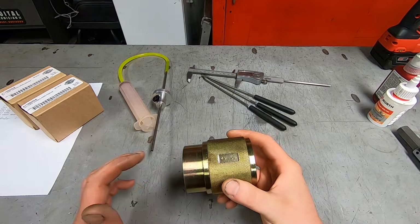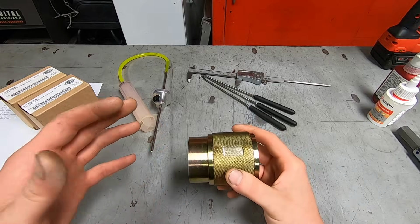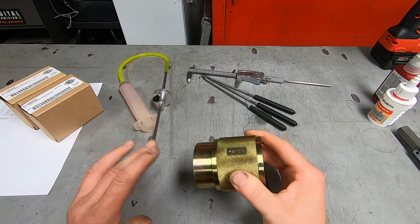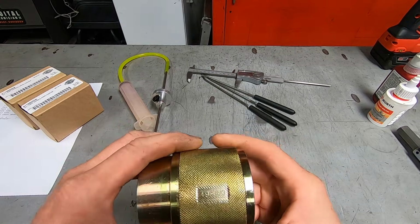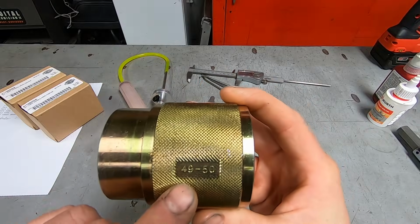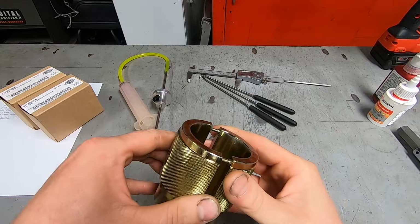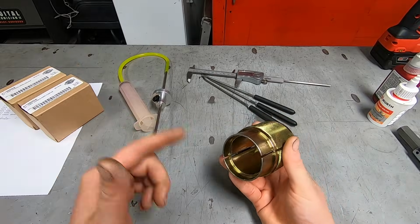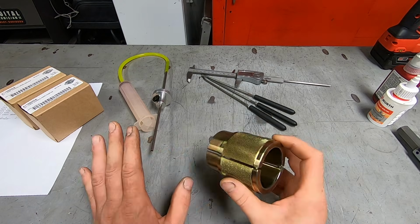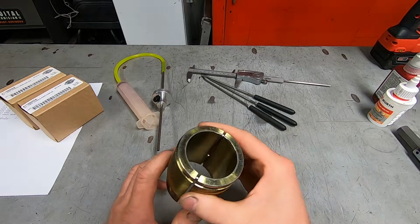This motorcycle is a 2019, but what I'm saying and doing is still relevant for anything 2014 to 2020. This is an inexpensive fork seal driver. I purchased it on eBay. It's for 49 through 50 millimeter forks. I will also put a link down in the description to where you can get one of these. If you don't have one, I've used PVC pipe at home. It works pretty well. It's not that big of a deal, but I do a lot of front forks. This just makes it easy.